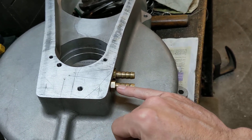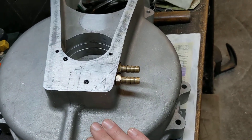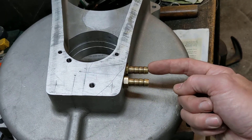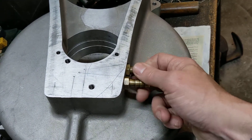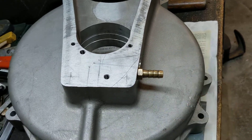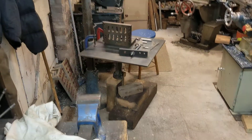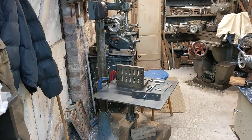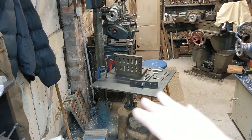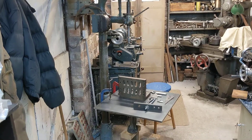This here will take oil back to the tank after it's been scavenged from the bottom of the engine case, and this one takes fresh oil from the oil tank and pumps it around the engine. The drillings for those are quite complex and took careful measuring, expertly done by Mr. Bob on the big drill. We're leaving that plate as we've had to lift it up and down repeatedly — it's on the jack and it's really stretched the capacity of that rather primitive-looking drilling machine.